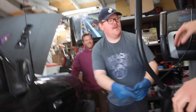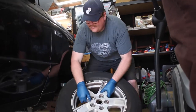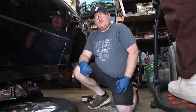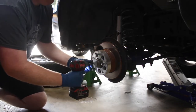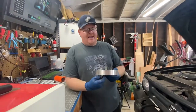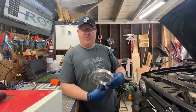I used my chrome one a ton until I saw some video that said don't do that. So it's really important that you have it on jack stands. But another safety measure, if you want, is to take your wheel that you have off and place it under the car, so it takes three or four failures before you are squished. I like to have as little failure points as possible. Safety first. These are wheel spacers and they aren't preferred because you want to have your wheel straight against any surface and have as few failure points as possible.